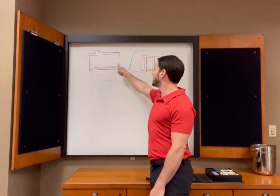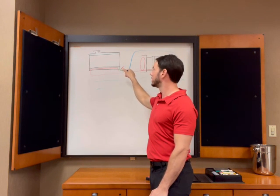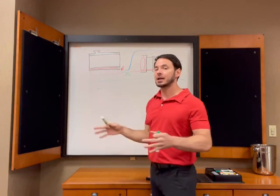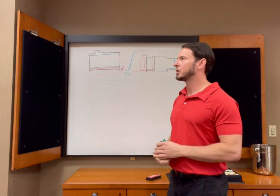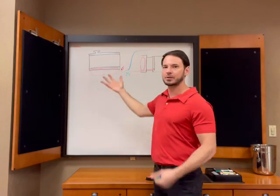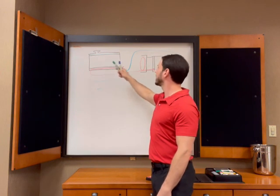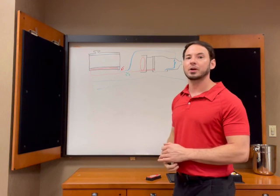If you have a radiator that is original to the car, and this is a 1992 car, I would recommend that you replace this radiator. If it was replaced at any time during the car's life, except for right away in early 1992, you're going to be fine, because when Subaru made the change, all of the service parts were destroyed and they sent out the updated part. If you've got a 93 or newer, your radiator's fine, your torque converter's fine. If you ever build a 92 transmission, that torque converter goes in the trash.